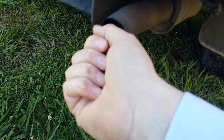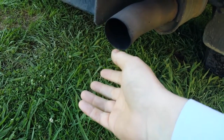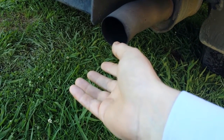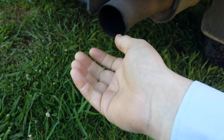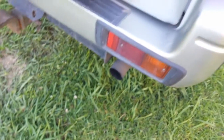But in this case the smell coming from here does smell a little bit like there's still a bit of unburnt fuel coming through, so we're not so far lean that we're going to damage the engine — we are lean enough to be getting fuel saving. This car has always stunk and I've hated it, but now it smells like a brand new car.